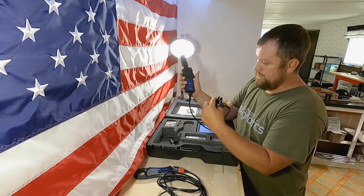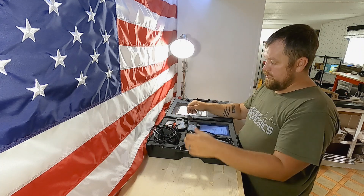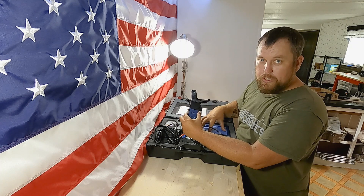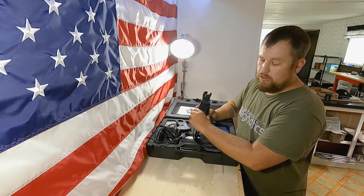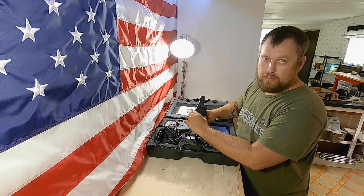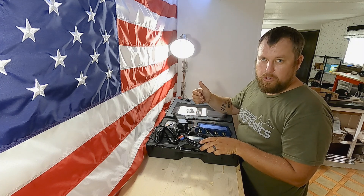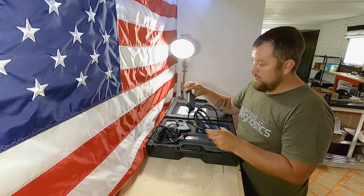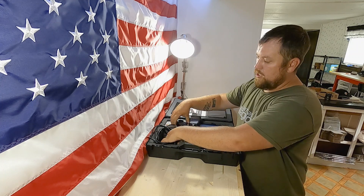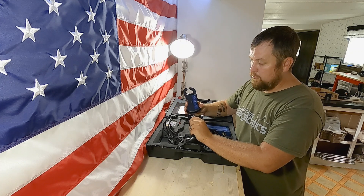The low amp clamp also has a great feature compared to the original ones — no more buttons, there's no more zeroing. The scope does it all for you. All you do is plug it in and it'll zero your clamps out automatically. It will also set the scope up for that channel. You can plug this into channel A and as soon as you look at your scope software, it's showing you've got the low amp clamp set. The only thing you need to change is how much current you're wanting to test. Doesn't matter what channel you plug the high amp clamp into — it's going to automatically set that channel up.